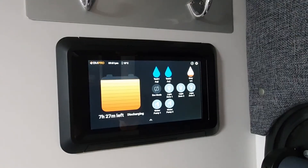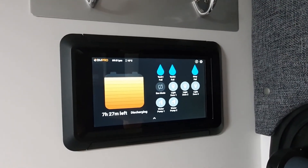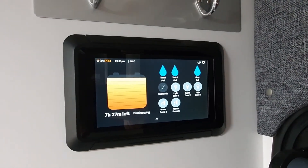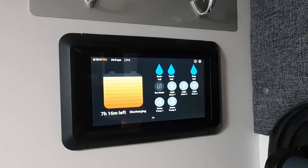Let's run that one more time. A little bit of saliva on the finger and then onto the pins on the back — there's no current or anything like that there. And there you go, the grey water tank has gone back up to full again. So there's nothing wrong with our actual connections, the water tank sensor, or the Odyssey link. Everything there is fine — it's just that they need to clean out their water tank.